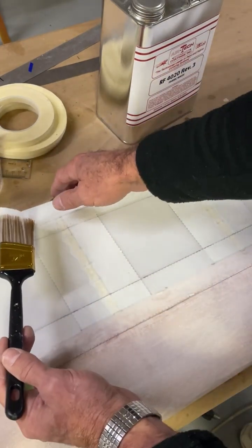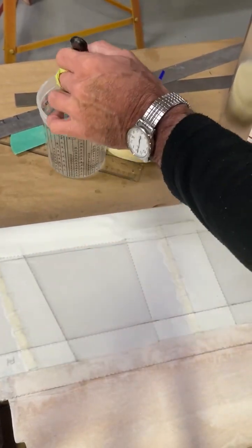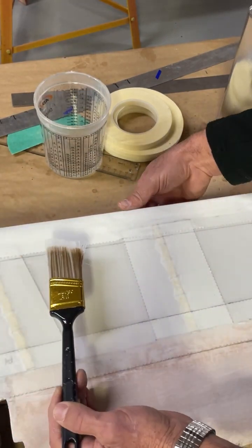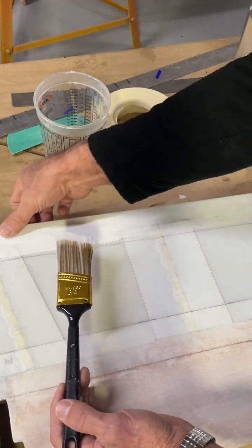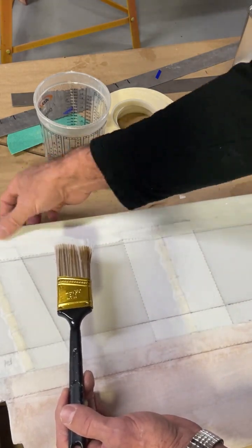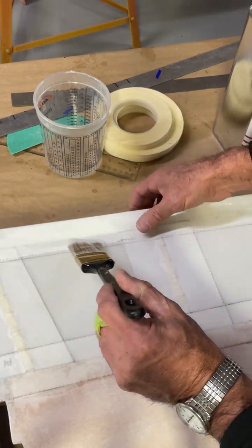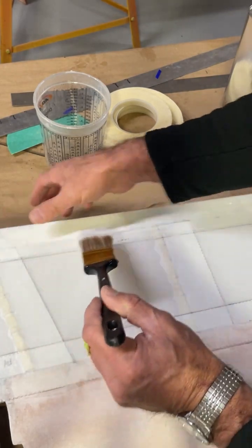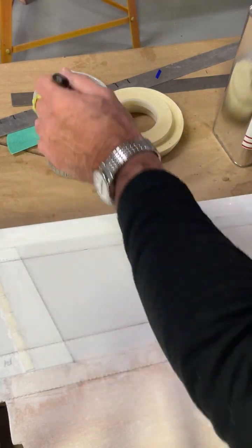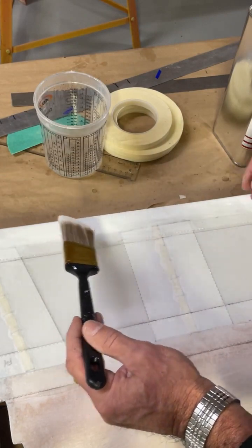Let me see if I'm still in the, I'm just about out of it. Turn it here. And I'll do about the first 1/2 inch and just wet a little bit. Do the edge. And it ain't gonna be much under it, soaked through, but just the right amount of dry, and it sticks pretty quick. And then work my way up and then bring it right up to the tips. So if you put 3 coats down, that's number 4 coat. You're gonna come back with one more, possibly 2. The extra one on top fills that weave for pinholing when you're doing the priming.